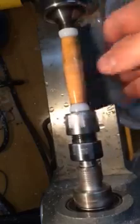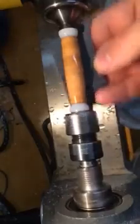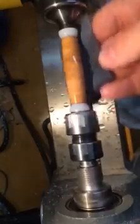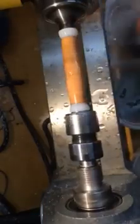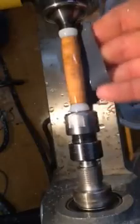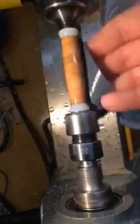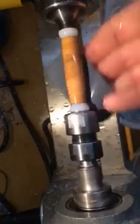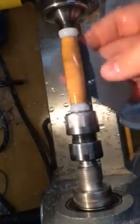The last one was 3,200. We're going to 3,600 now. Like I said, I'm spending about 10 seconds per pad, give or take a couple seconds, making sure to get the base of it, and then at the end showing the edges a little bit of love. Constantly moving. That's what's going to ensure you have a good consistent finish. It's 4,000. We're doing 6,000 now.